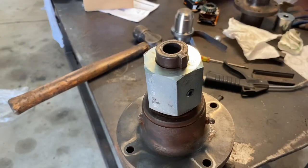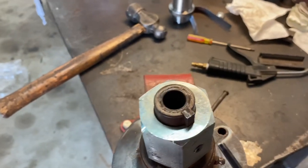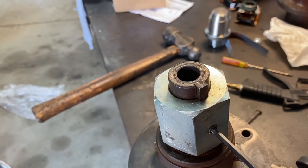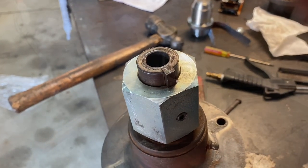The first step is to put this spindle holder on your spindle. Obviously it's keyed. As you can see, I'm just using the same key — they do provide two keys in the kit. Then you can use this set screw to tighten it up and hold it in place. This all fits pretty tight; I don't know if the set screw is necessary, but I'll do it anyway.